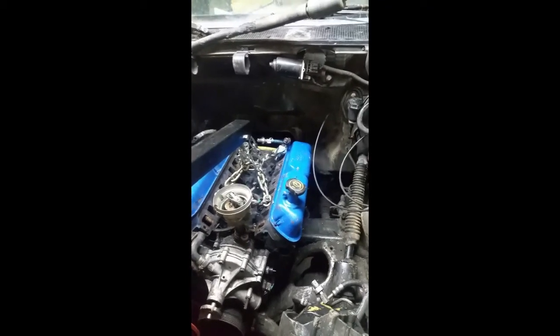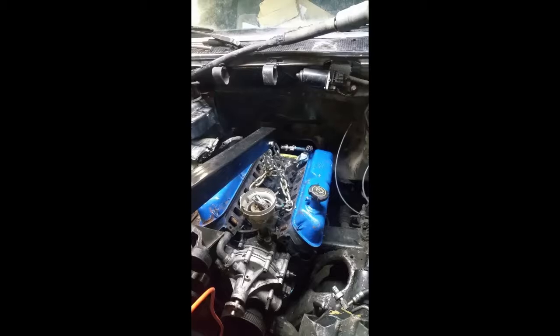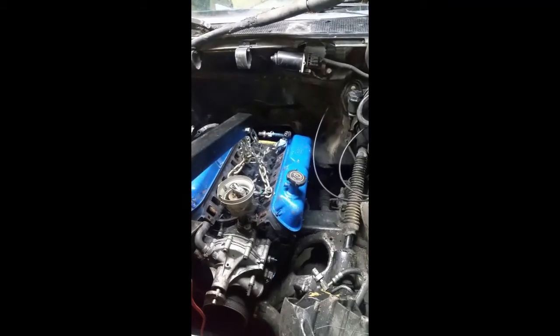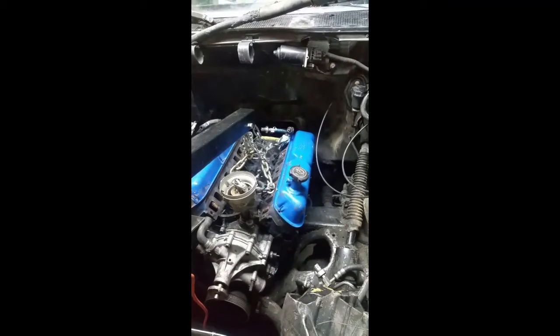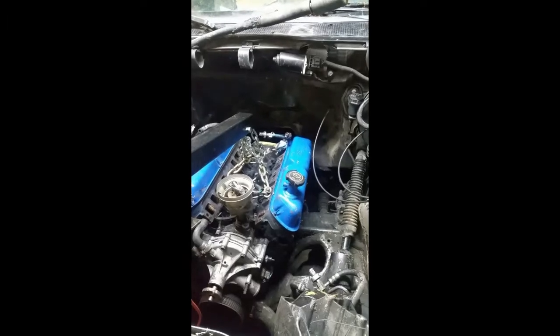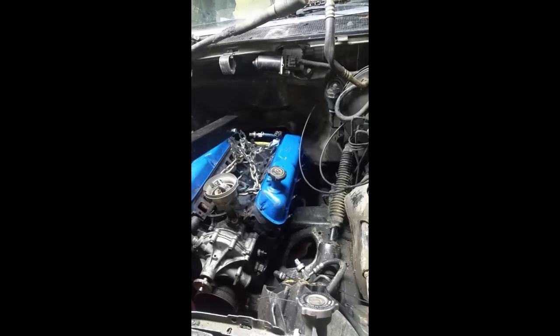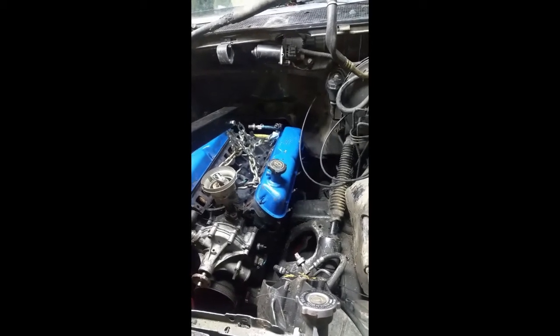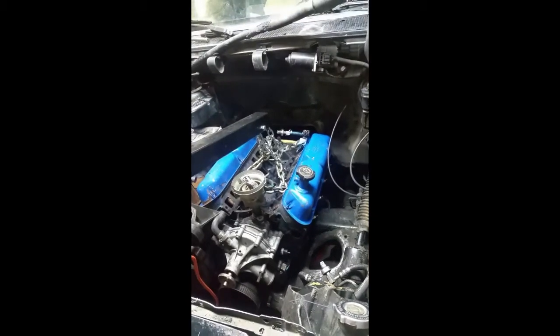pushed on it a bunch more, and then eventually got a bolt in the side and pulled it in, and then worked all the bolts in the sides. We were a little bit worried because it was pretty hard pulling it in. It just didn't slide in there easily. But eventually it's all the way flush now on both sides, and the studs are in. And so we're just hoping everything lined up well. There was a little cap on the bell housing that we took off, where you can make sure your rod is getting inside the flywheel and the clutch. So we were able to make sure that was lined up, and we turned the crank a little bit just to double check. So it was in, and then we just forced it in there. So you're just in for a good workout.